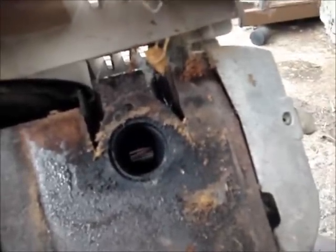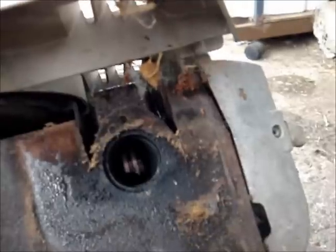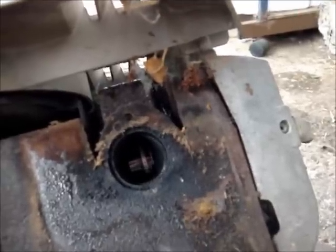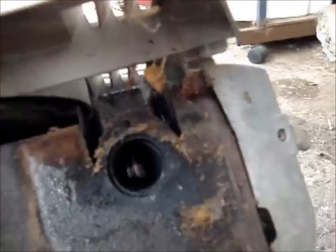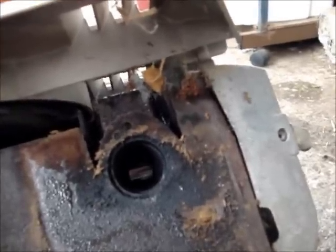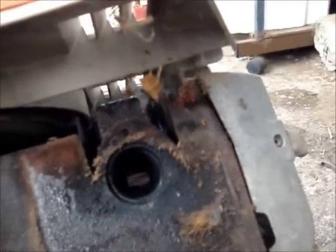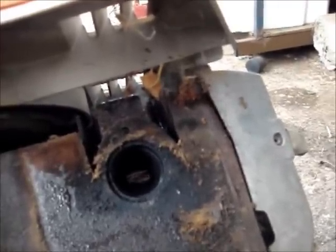Rings are sad. I can polish that piston up. It's salvageable. There's a few little scores on the piston. I'm not too worried about them. I'll just hone the bore and put new rings on. It'll be right. Hasn't run for quite a long time. Bit of carbon build up in the exhaust, so I'll clean that off and that'll be right.